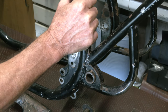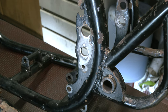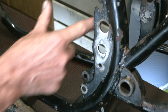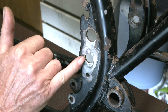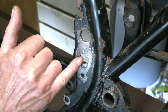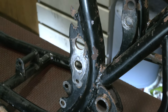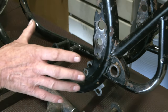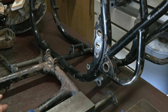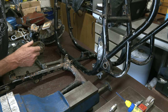Just show us the insert for people who don't know what it is. Well here, this is where the swing arm spindle goes. This is a swing arm, and through the end of this tube here there's a spindle that runs through. These inserts have been put in because possibly that was worn over size and they wanted to drill it out and put these inserts in. I've got a feeling back in the 70s someone started to do this bike up to their own spec. We noticed that there's a lot of parts have been chromed, and it was a project that never was finished - that's where we have picked it up really.